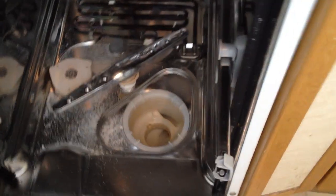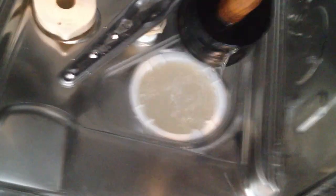This machine has already been cleared. Get a normal plunger and a kettle, and fill the bottom of the dishwasher with boiling water from the kettle. Use the plunger to plunge out the machine. Do this for several minutes, then leave the dishwasher for a good half hour, then repeat.